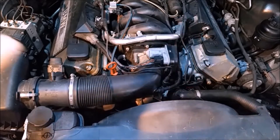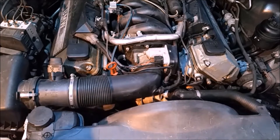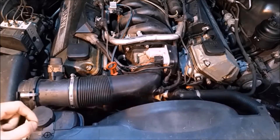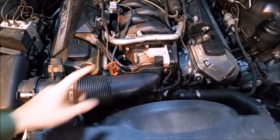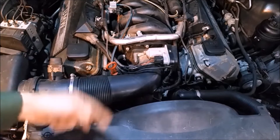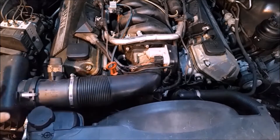For some reason, BMW put mechanical fans in all of the E39s, including the M5. These mechanical fans are a ticking time bomb because what happens is over time they're exposed to so much heat, they'll lose part of the blade and get really imbalanced and just completely catastrophically fail — taking out radiator hoses, your intake tube, all of these vacuum lines, probably your radiator, your expansion tank. A lot of stuff is going to die.